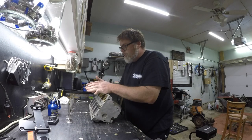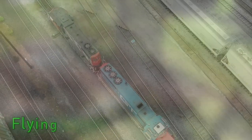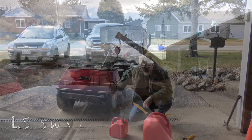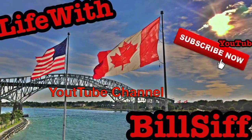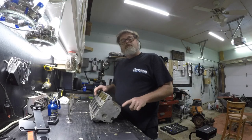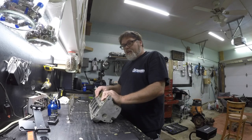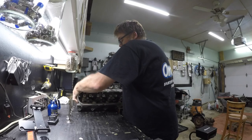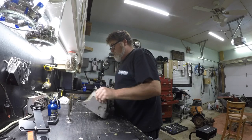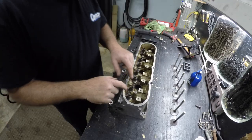Get the valves out of the head in order — better make sure you don't screw them up. Welcome to Life with Bilsa, by the way. I'm going to remove the valve seals with you. We're going to try to get this head cleaned up and maybe install the springs on this head. So what we're going to do is pull all these valve seals off and then we'll go from there. I'm going to grab a little tool and pop all them off.